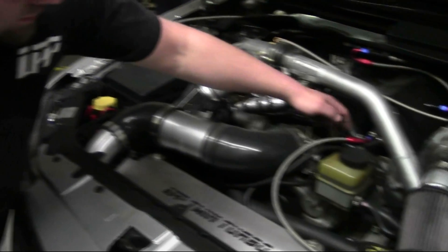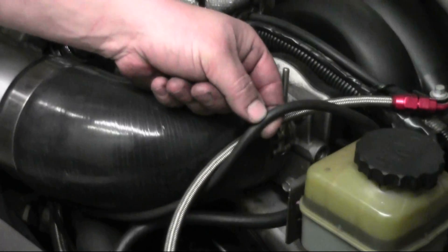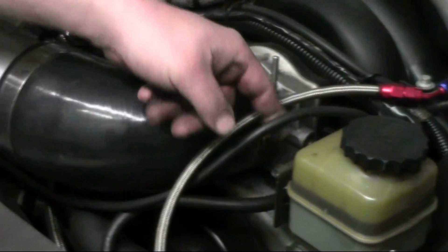For the vacuum routing on our HOB switch, on this one we tied it into the existing vacuum line coming right off the back of the throttle body — the same hose used for a blow-off valve or boost vacuum gauge — basically anything referencing boost pressure. When it hits 5 PSI it will activate the system and you'll have more than double your fuel volume. The HOB switches are adjustable — they come preset at 5 PSI, but there's a small rubber plug in the back you can pull out and insert a 3/16-inch allen wrench to adjust. Screwing in raises the boost pressure at which it activates; unscrewing lowers it.